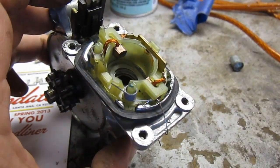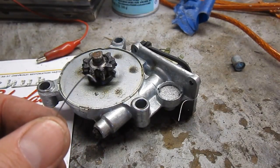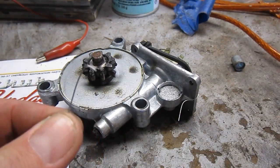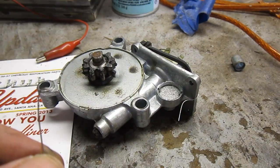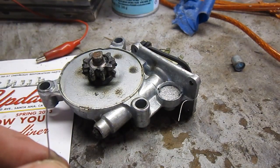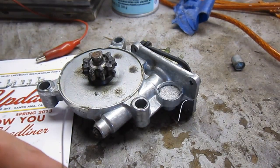I'm going to do the same thing for the other side. This is really hard to see because it's so tiny, but I'm making a hook. I don't want to make too sharp of a hook because I'm going to try to pull this out. I'm just barely putting a little crook in it — it's not a severe hook at all. When you're making this, just barely make it so it has enough of an angle — more than 90 degrees, maybe a 95 to 100 degree angle. That way it will hold the spring but not get hooked on it and never come off.